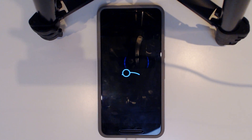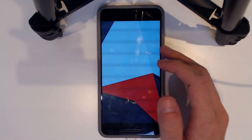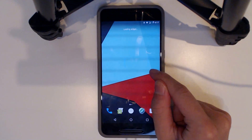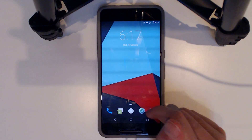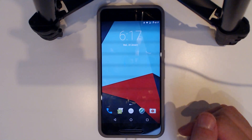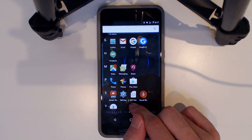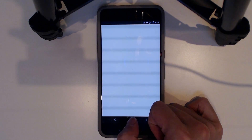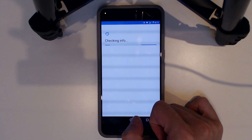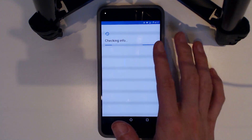I'll fast-forward until we get to the Android home screen and check things out from there. Every time we clear the cache it takes a while — that's expected. We may get a few force-stops here and there, but clearing the app data should fix that. We can see the Google Play Store, along with Gmail, the Google app, and the Google Now Launcher. When you open the Play Store, it will ask you to add your Google account, or you can do it manually through Settings > Accounts.